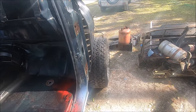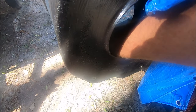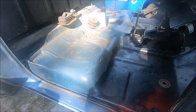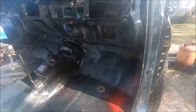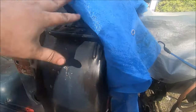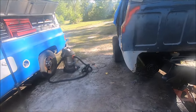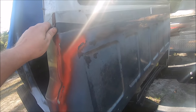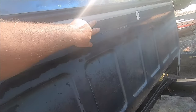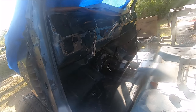I think I'm just going to stick seam sealer in there and give that whole area a coat to waterproof it. There's no point really replacing the metal because it's going to be sealed up good. With all this taken apart I can reach in and access it to cover that up. I've already put rust converter on it. I'm going to seam seal everything all at once and clean and seam seal the cowl to make sure it'll stay watertight for the future. I'm also going to take off this clip and zip off these trim nuts since I'm not putting trim on.